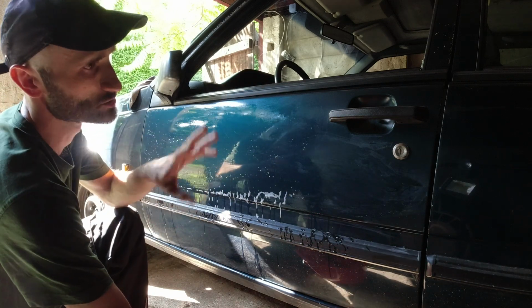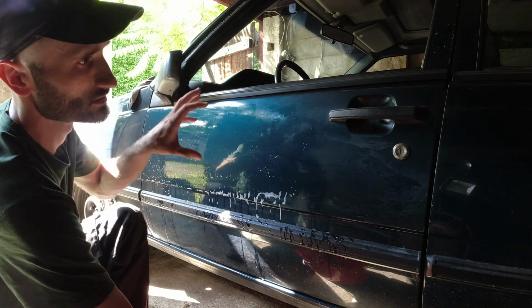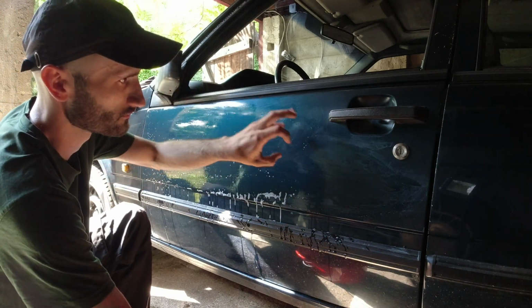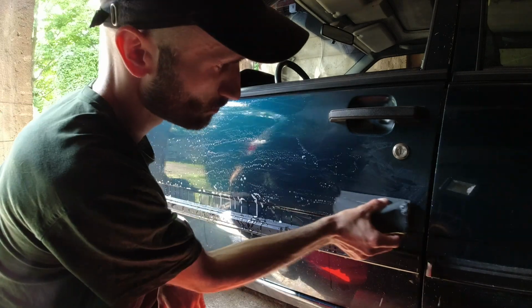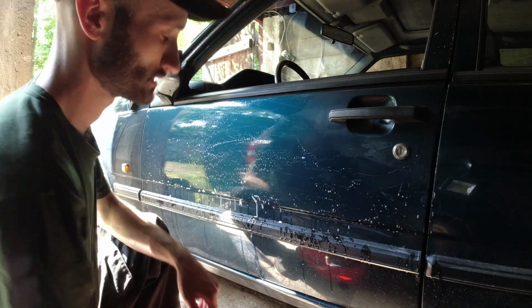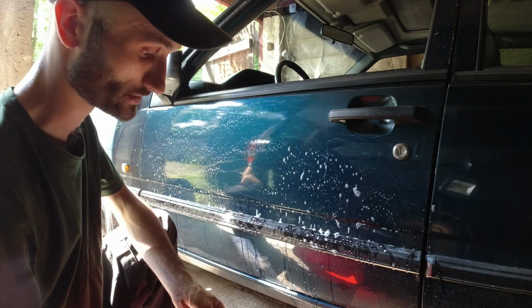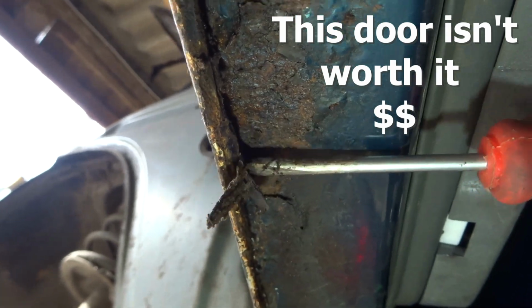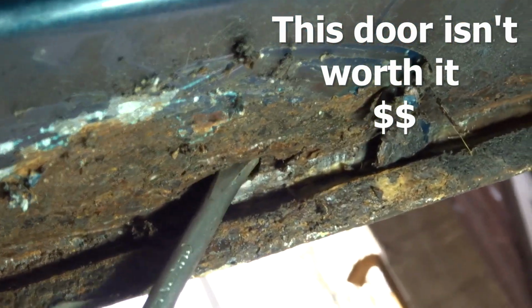So when you clear coat over the top of that, you'll have your shine, but it'll look different to the other panels because you've wet sanded away the sparkles and the flakes and the effect in the paint. We might get away with it. We'll see how it looks. Hopefully it doesn't stand out too much. I don't want to be spraying more base coat again. Oh.